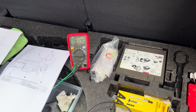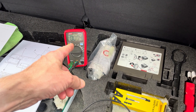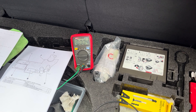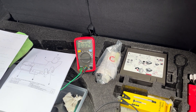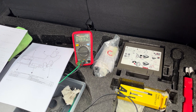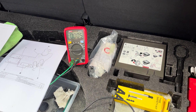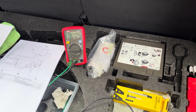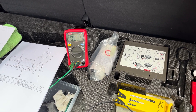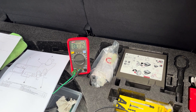As far as I'm aware there's nothing else wrong with the electrics in this car other than the current drain I've now dealt with. Drawing this small amount of current, the battery is going to last a long time — you could leave it four weeks on a fully charged battery and it wouldn't have a problem starting. As a reference, if you've got a Mark 2 TT and you're seeing 50 or 100 milliamps, you've definitely got a problem. I'll put notes in the description, and any updates will be there too.